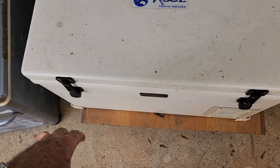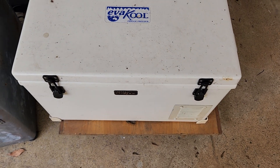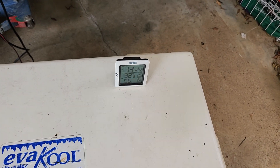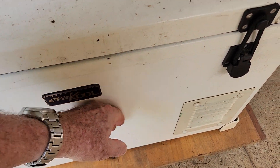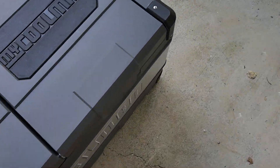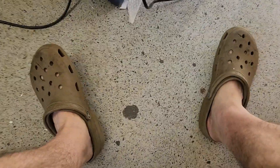This early Evercool was basically an Esky that they built into a fridge - very good, works really well and never misses a beat. Simple operation, no electronics which is great. Vent on the back, exit on the front, moves a lot of air through there - quite an efficient cooling arrangement. The other good thing about these Evercools built locally is they have about 38mm high-density cool room insulation as I understand it. They use proper insulation, and the result is when running it as a freezer, cool loss through the sides and lid is absolutely minimized.